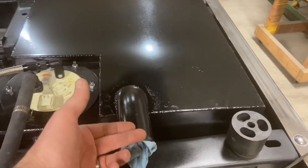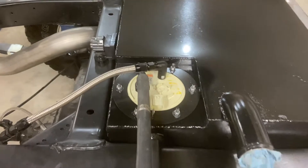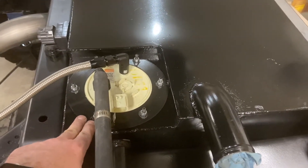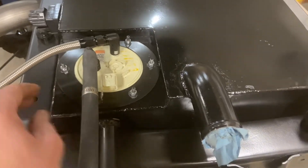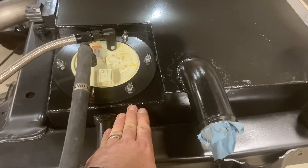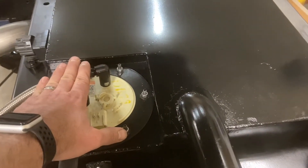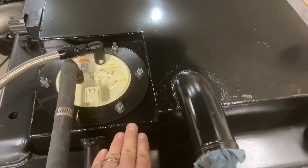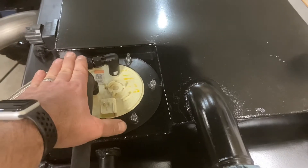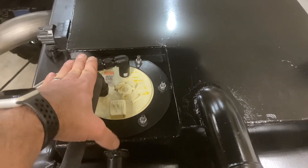In order to meet up with the inlet or spout from the fuel filler, we bring the inlet for the tank up just a little bit. We also recess our fuel pump. The tank itself is about 13 inches deep but this fuel pump likes to sit at about 12 inches, and by recessing it we get about two inches of clearance from that point up to clear the hoses, so you can reach in and make adjustments without pulling the body or dropping the tank.